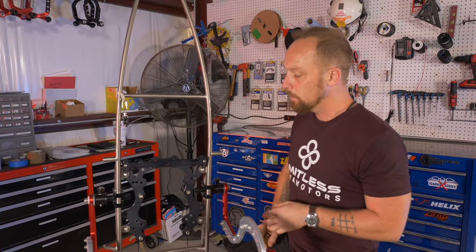You can alter the length of the swing arms. Personally, I set my carabiner strap on this center slot here, and then I bring my arms out. You can go up to 5 holes outwards, and that's the max limit. So that'll give you a bit more arm room. I find that it's easier to land my paramotor when I'm on this center slot here versus the front slot. So if you're a heavier pilot and you're having a bit of trouble with it leaning back on you when you're landing, one of the things you can do is, well, we'll show you with a TCS setup. You can raise this up. You can also go 5 holes out, go to that center slot, and that'll really increase the landing capability. So these are just some of the things that you can play around with.